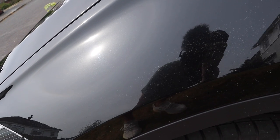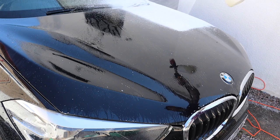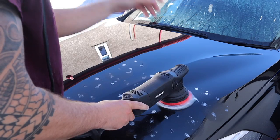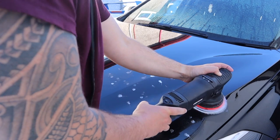So the plan of action is I'm going to wash the bonnet, I'm going to fully polish it, correct it and get it ready to go. To do that, I'm going to use a citrus pre-wash, a snow foam, I'm then going to use the Infinity Wax Wax Off shampoo, then we're going to decontaminate it and give it a bit of a clay bar before finally giving it a good polish.